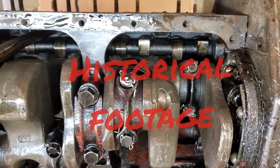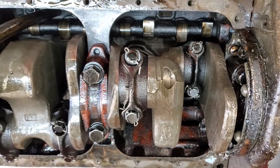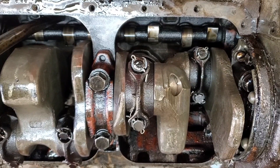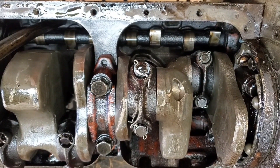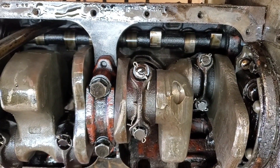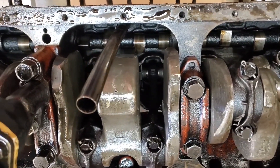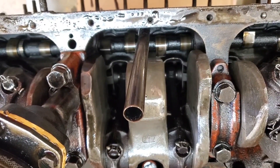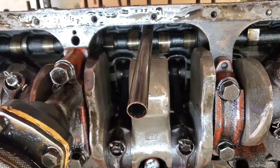Here is the underside of this car's engine — the 1939 Graham we're restoring for a customer. One of the things you see immediately is it's full of cotter pins. They're not supposed to be cotter pins; those bolts are supposed to be safety wired. And there's no safety wiring on the oil pump at all. That's another thing we're noticing that's particularly wrong.